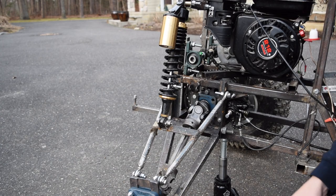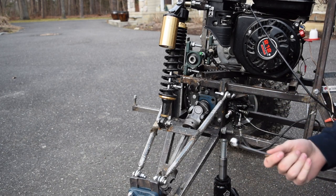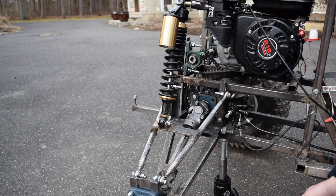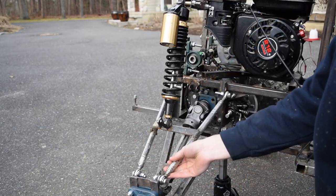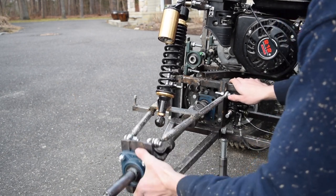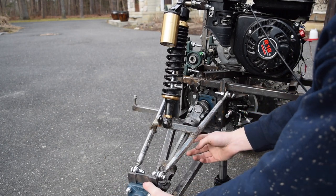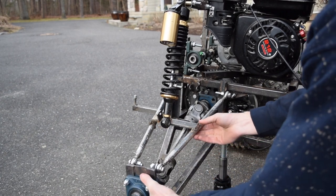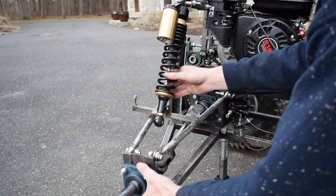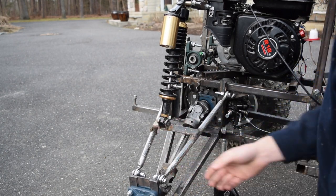Now I'm going to explain how my universal joint system works. I'm going to take off the rear shock — using a 14 millimeter wrench and 14 millimeter impact socket. Now you can see how this system works: it's essentially a dual A-arm setup, top and bottom, and the universal joint axle slides in and out of the upper universal joint to allow axle movement with suspension flex.